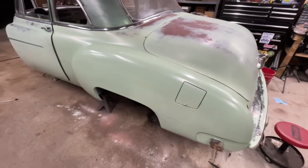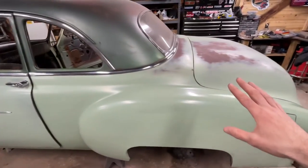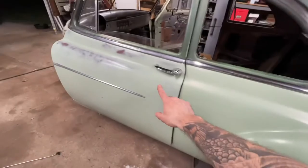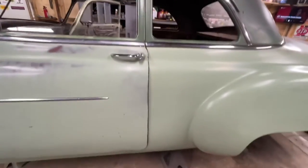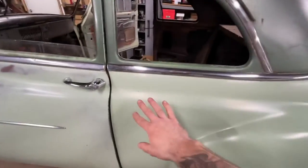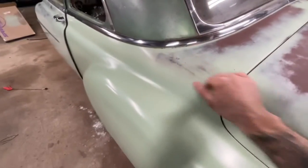I'm not gonna lie, I'm really pleased with the color match that I did here. I think that once I start to wet sand this through and make it a little more dull like this, because you can kind of see the red coming through here and here, which makes it look a little different shade, I think that this is gonna match so nice. Get that patina showing up here. This crackle effect here, once you start sanding on that, it'll match all this up here.